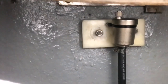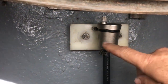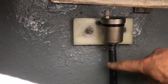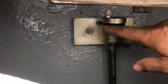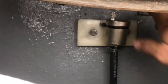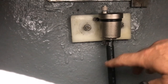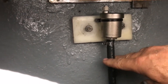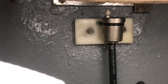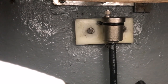I got this idea from a website called marinehowto.com. It's a vent for a hydronic heating system in a house - it allows air out, and then there's a float inside that closes it off once water reaches it. It is made of brass, I believe plated with something, probably zinc. It's mounted high enough where if the boat heels it wouldn't be an issue, but even if it did, the vent actually closes because of the float.